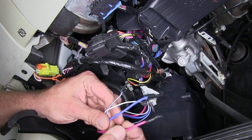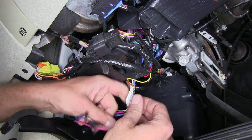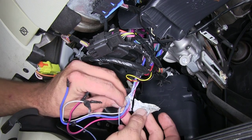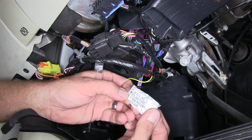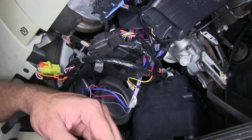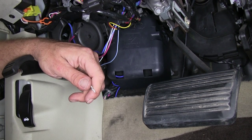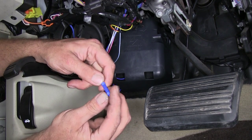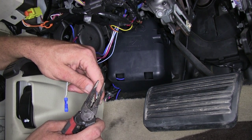You can see we've got a red with black, dark blue, a white, and then a light blue with white. Let's pull off our tag here as well. You'll see on it it's going to tell us what we need to connect where. We need to look at our brake controller instructions — it's also going to have instructions for what wire goes to what. We'll start with our ground here and strip this off, then use one of the smaller butt connectors provided with our brake controller.